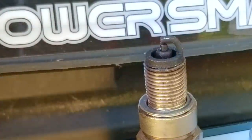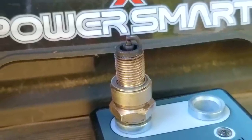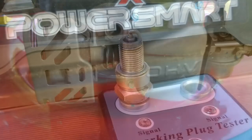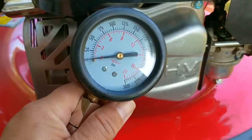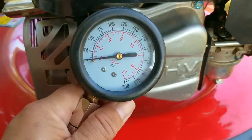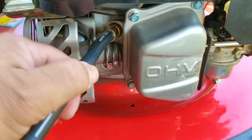The spark plug is working just like it's supposed to. To properly test it I'd need to put it into a pressure vessel and run the test again, but I'm not equipped to do that so this will have to do. At least we know the ignition system is working. For the compression test I'm going to use my compression tester — it measures how much pressure the engine can make on the compression stroke, and we want to see a reading well above 100 psi. If you need one of these there's a link in the description.